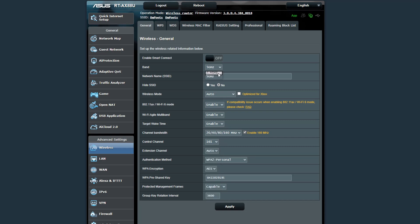Let's check out the 2.4 gigahertz. I leave 2.4 on auto because I almost never use it, and even when I'm outside I'm still on the 5 gigahertz channel. 2.4 gigahertz is a slower signal — it goes further and has better range, but it does get a lot more interference. If a neighbor suddenly turns on the microwave, for example, you might get some interference. So I just leave this on auto. The channel differences do make a big difference, so definitely use that Wi-Fi analyzer, but for me auto is fine.